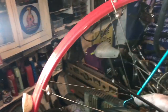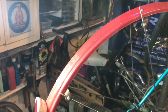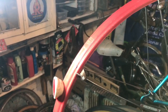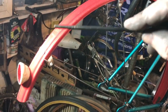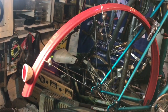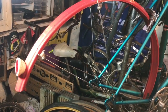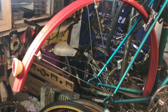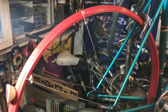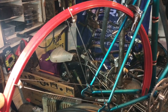If you need to do an adjustment on the road, slacken off all four and let the mudguard stay out of tension. If you've got tension in the mudguard, that's what induces premature splits and cracks — and that's why a lot of people don't like these plastic mudguards. Most of that is due to incorrect fitment: people fit them under tension, twisting, or under forces all the time, and it's not good.